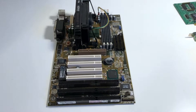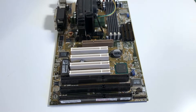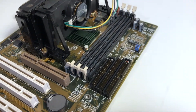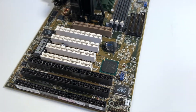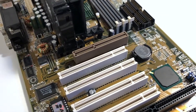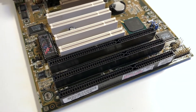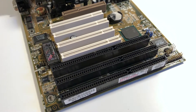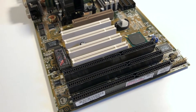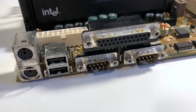I'll start with the heart of the system. This is the ASUS P2B, which was a very popular board back in 1998. It's based on Intel's 440BX chipset — the first chipset to officially support a 100 MHz frontside bus for some of the later Pentium II processors. The first generation used a 66 MHz bus. This board really has everything that 1998 had to offer, including AGP, which was still fairly new at the time, some PCI slots, and ISA slots, which were still pretty popular. This board has three ISA slots — a lot of boards around this time only have two, so that's a plus. The board is in pretty good shape; there's a little bit of corrosion on the rear I/O ports, but overall it works great.